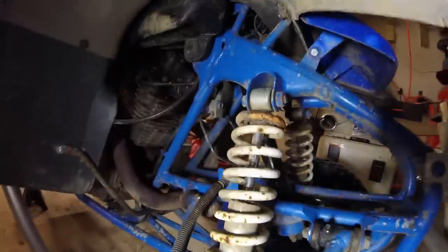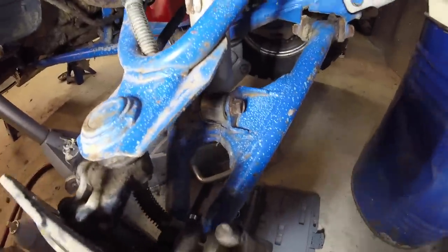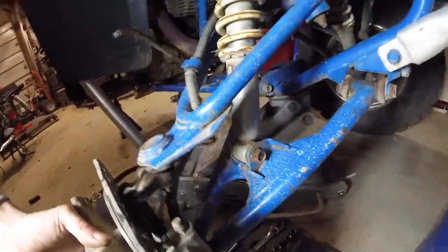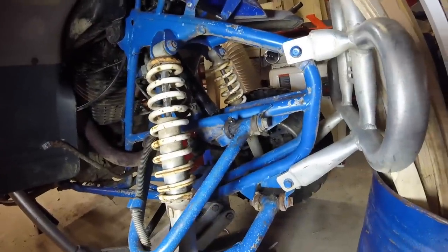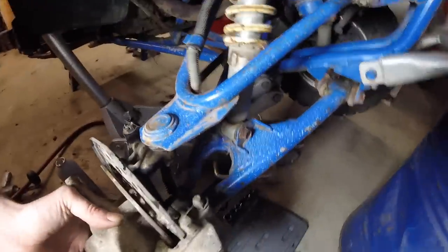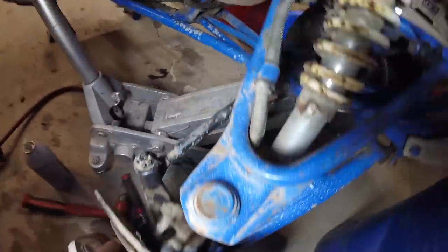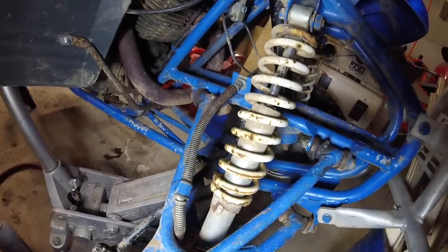Just found another issue in the shock. When I lift up, that bushing is shot. Now this whole front end is just done. Like, the whole thing needs rebuilt. Control arms, brakes, bushings. Tie rod ends were definitely replaced, I think, because they're black. But, I mean, yeah, that's pretty bad. I could try to shim it, maybe. But I should probably just buy new shocks.